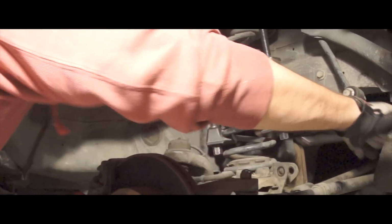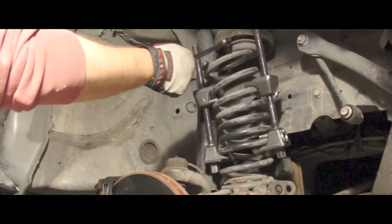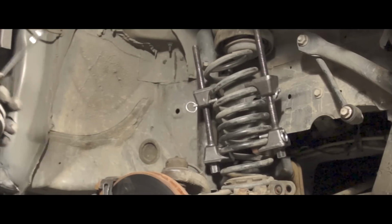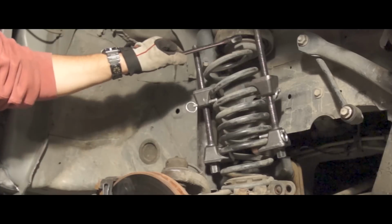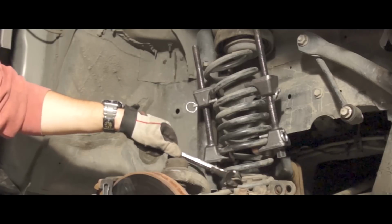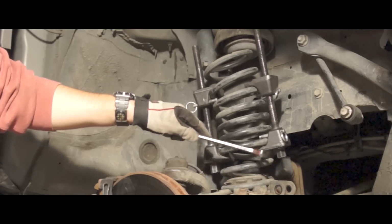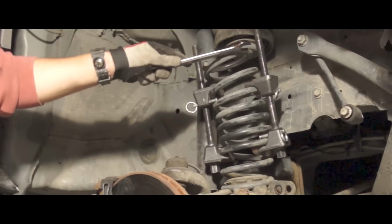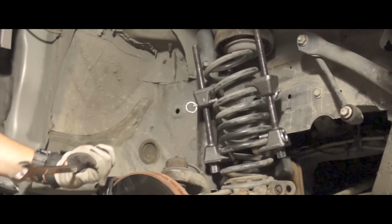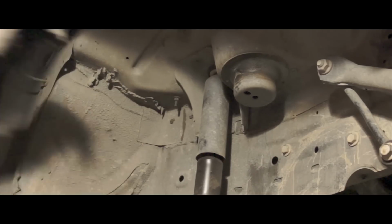The tough part about this is that the top two rungs are pretty much buried into the insulator, or the isolator, on both sides when it's finally assembled. So I can't get the compressors around either the bottom two or the top two rungs, just because there's no room for it to fit. Okay, spring and isolator removed.